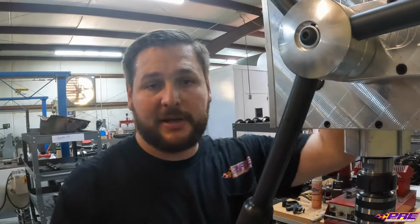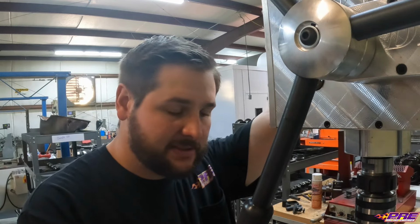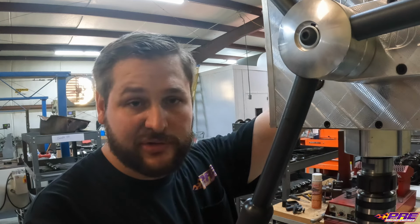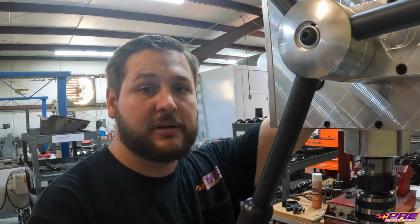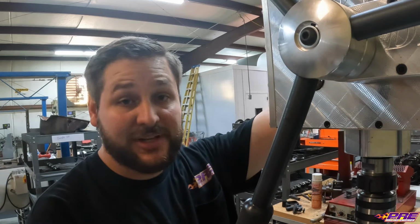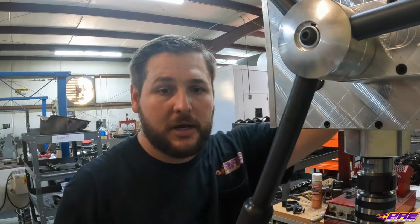Alrighty, so we got it set up in our stand for drilling our heavy metal. Worked through that process. Obviously, we'll have to drill, ream, and everything. So we still have a press fit with our heavy metal. It does come slightly oversized, so our ream does provide the right amount of press fit. So we'll get started.